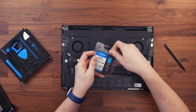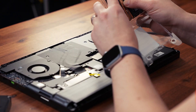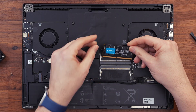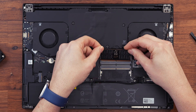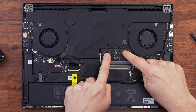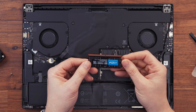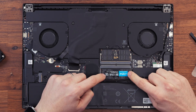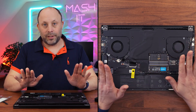We get our new 128GB RAM kit and carefully take one stick at a time. All we need to do is match up the little notch here with the notch on the motherboard. This chip at the top needs to go in with the sticker facing down. Put it in at a 45-degree angle, and once it's seated in nicely push it down and listen for the click. First chip in. For the second chip, match it up with the notch, slide it home, and again push it down until you hit a click. That is our RAM seated in place in the motherboard — nothing more to do with that RAM.